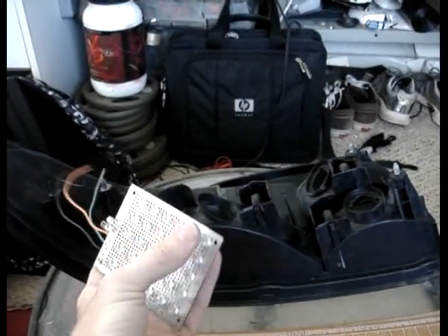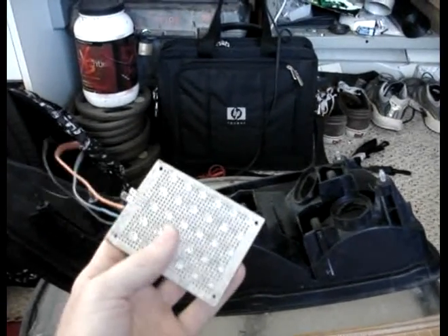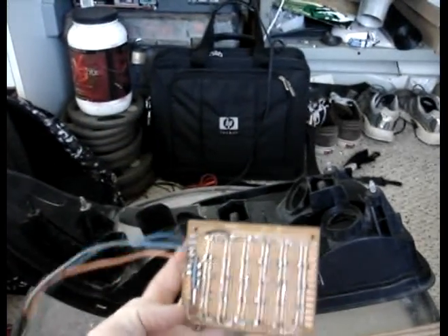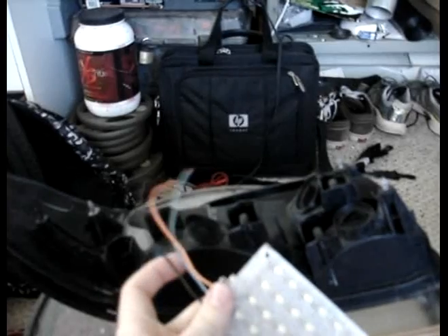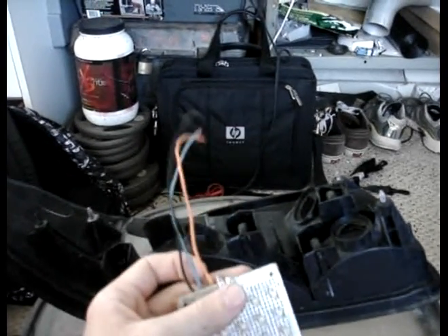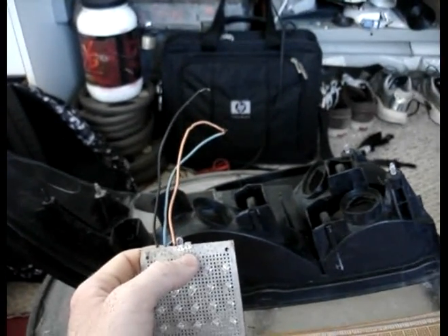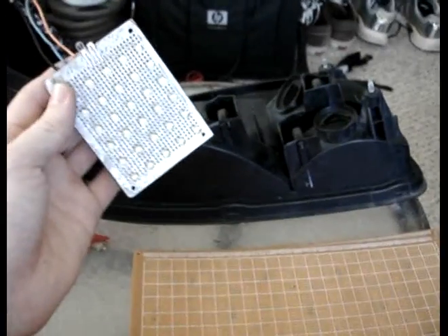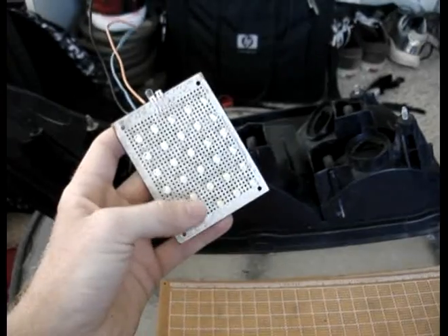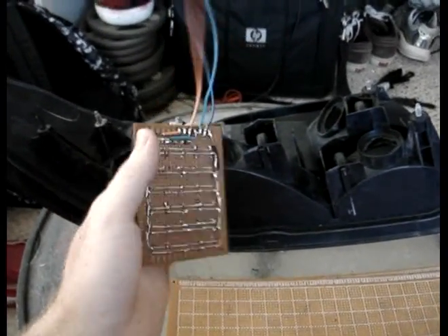So these collectively are wired in series behind these two. The running light works fine, which is all of these 30 ones behind the one resistor — that little blue resistor right there. That's on the black and orange wires. The running light brake light is black and blue. And these two are wired in series behind these 30.